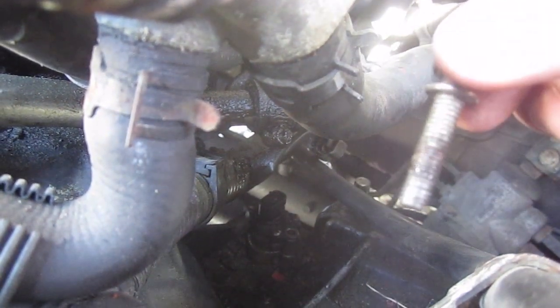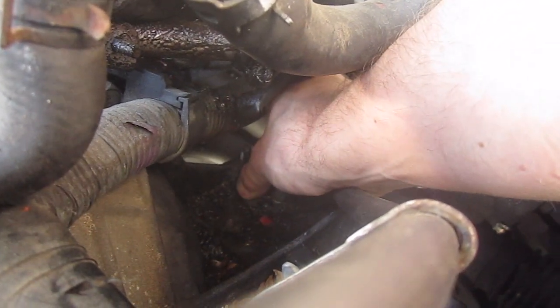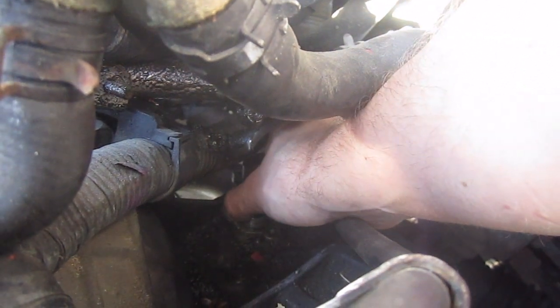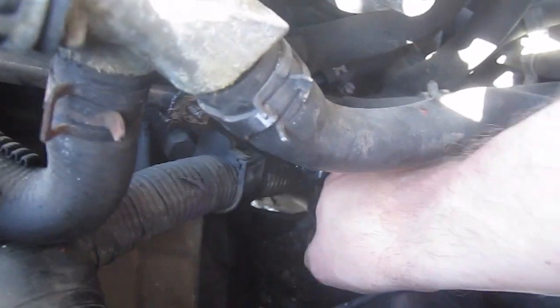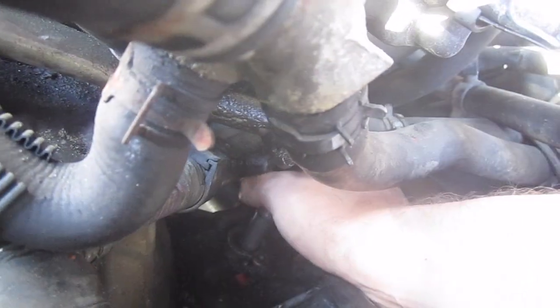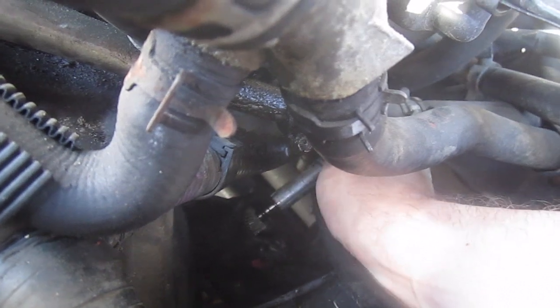There's some gunk in there where it's been done more than once. The sensor — your new one may probably have a tab on it, I'll show that in another clip — but all you have to do is pull straight up on it. The first time I did mine it was really tough to get out. These sensors on this car lift straight up and then there's a shaft, and it's also got an attachment to it so you will have to sort of push some cabling that's under here out of the way to get the whole assembly to come up — with two hands this would be easier. So you're going to pull it out and you want the gear shaft to come out with it too.